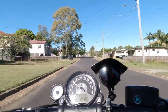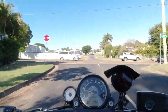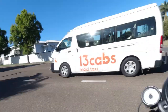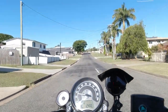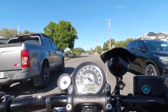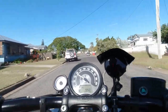Right, that's a good spot to have a break. I got all that bolted back together, all the oil lines and everything on, and then went for a ride. Hopefully that oil leak is sorted out - I'm pretty sure the crankcase leak is sorted out but I'm still having a bit of trouble with the banjo connections on the back of the supercharged oil tank. It's got a flat spot right down low I've got to get rid of, and everywhere else it's way too lean.